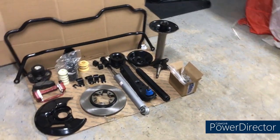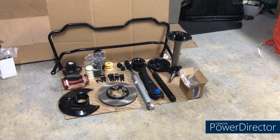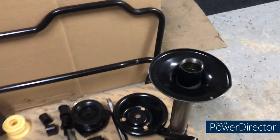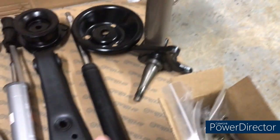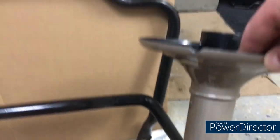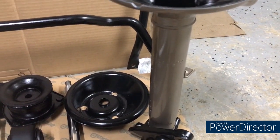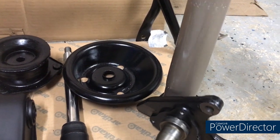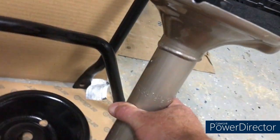This is all the stuff I've been prettying up — for me that's part of the restoration: to try to make things look new. Not only are we bolting new parts on where they're worn out, but we're trying to bring everything back to look new. I'm putting new KYB cartridges in here — there's a video on converting these from adjustable to non-adjustable. I've sanded it down and refinished it: I painted it a gold color — actually it's BMW 'Sahara Beige,' left over from the BMW convertible project that was here last. I threw some clear coat on it and I'm really pleased with how that looks.